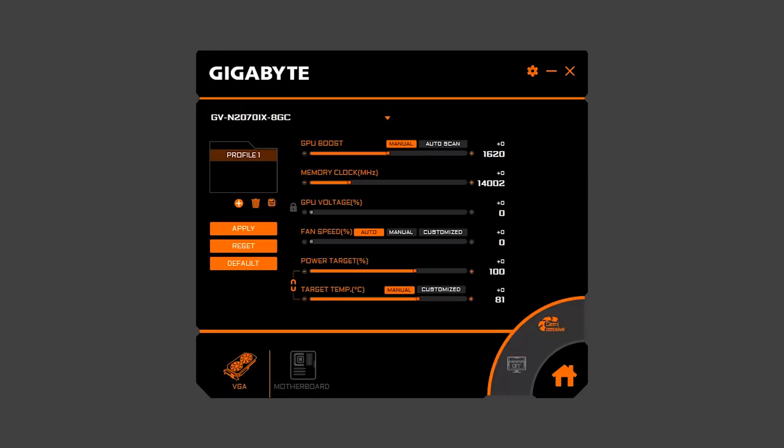If you're looking for the maximum overclock that a 2070 can offer, this is simply not the card for you — these compact cards are not built for that. With that said, I was able to push the core clock up to 1,950 MHz; anything over that became unstable, benchmarks wouldn't finish, and some games were crashing. You may be able to push it a little higher in your system, but you're not really looking for liquid-cooled 2,200 MHz performance here. This is a compact card designed to fit into compact, compromised-airflow systems.